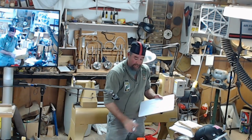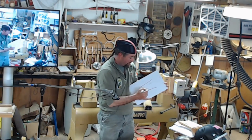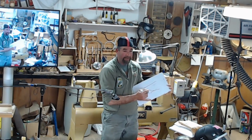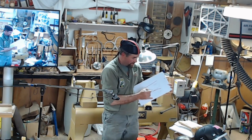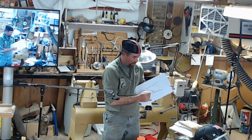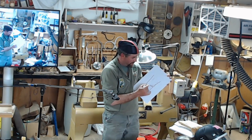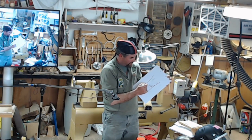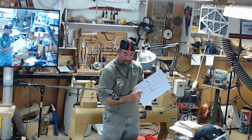So how deep should your notch be? Very good. You want at least a minimum of like five to 10 inches, the size of the opening of your notch. You don't want to have this little baby skinny notch, because that's going to close up so quick and force this thing. And usually when these things start to go, this whole piece will split right up here, and that's when that barber chair comes back at you.